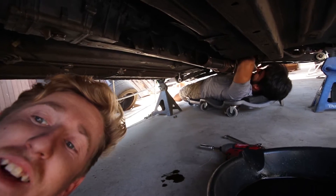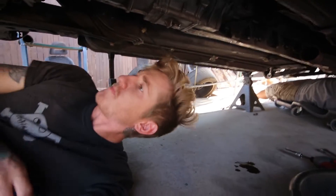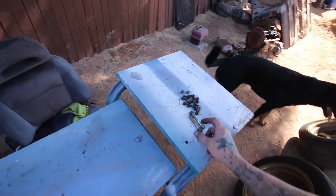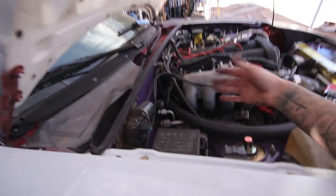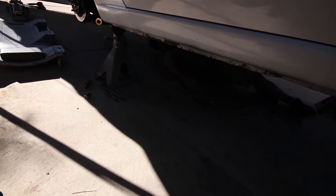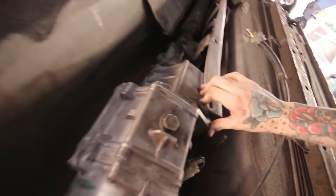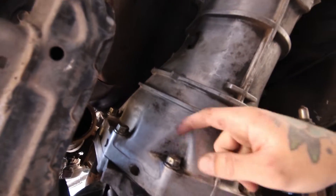Still working on the driveshaft — well, I shouldn't say 'still,' we've only been down here five minutes and it's going relatively quickly. Once the driveshaft is off and I get the starter off, it's just the bell housing bolts and we can pull it. The starter has two 14mm mount bolts and a 12mm that holds it to a plate by the engine mount — I think that plate holds the starter, so you can just unbolt the two 14s and pull the trans. Driveshaft is out, sliding the power plant frame over; there's a ground to pull off, then PPF off and trans out.